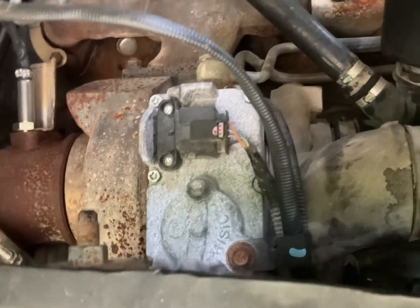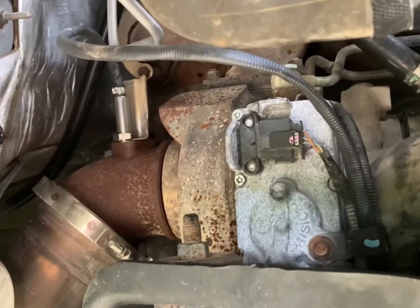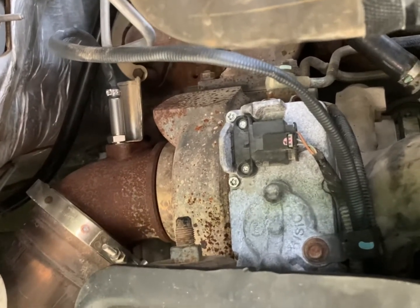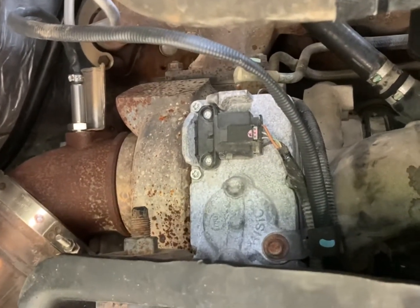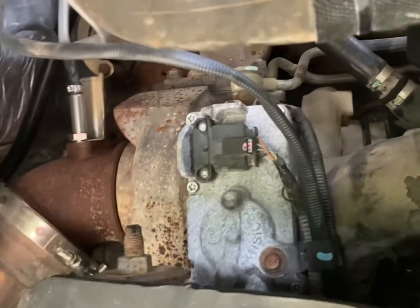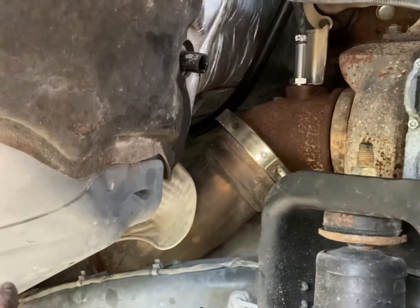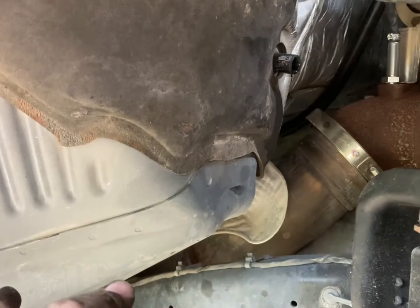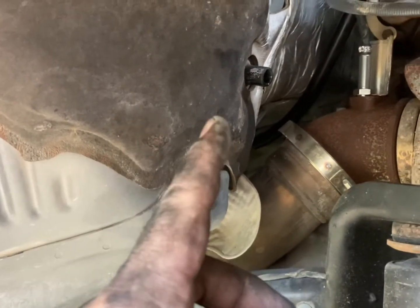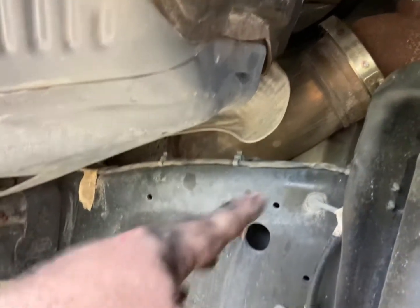After this installation I'm going to use my OBD2 reader to clear the code and let the computer learn as I continue to drive, and hopefully this has fixed the check engine light. There are two other sensors in this SCR system: NOx sensor 2, which is on the back side, and the DEF fluid sensor along with a temperature sensor. Just remember — upstream sensor 1 is at the turbo intake, sensor 2 is in the back, and the modules are on the frame of the truck.